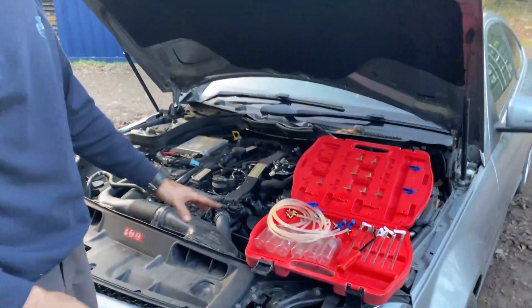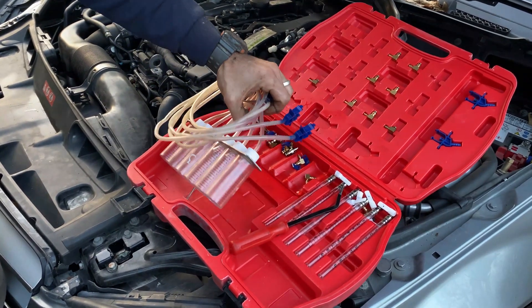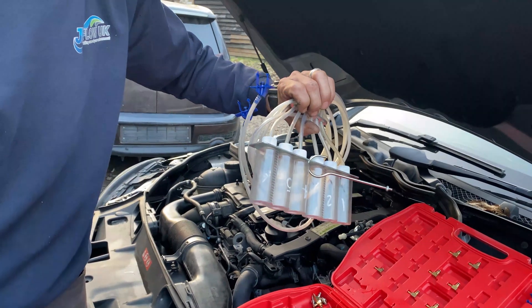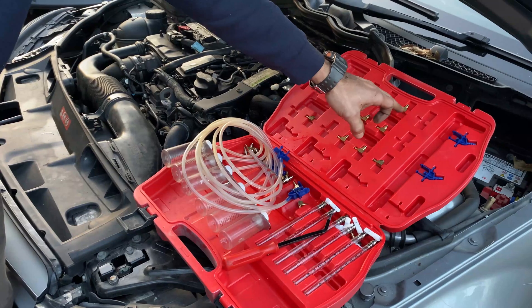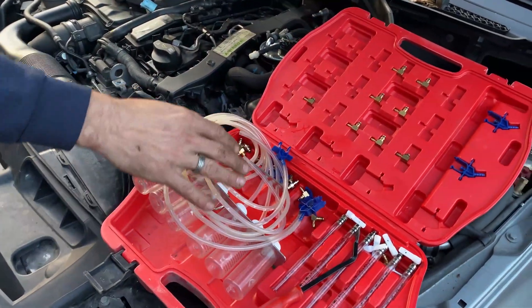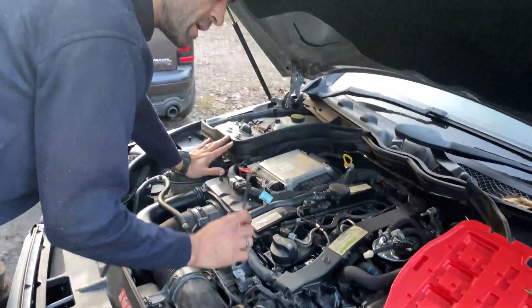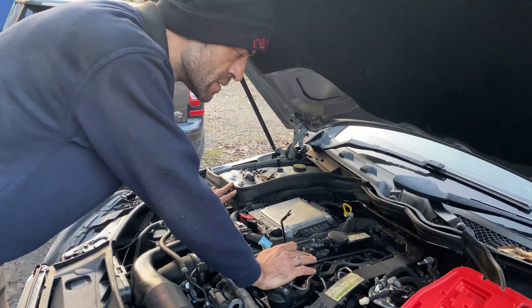Let me show you what we need. I've got a 35 pound diesel return test kit. It's made to suit a six cylinder vehicle — we'll only be using four of these. It comes with a whole bunch of different return line attachments to suit the vehicle. Once your vehicle is warmed up and is at operating temperature, that's the ideal situation to do a return line test.